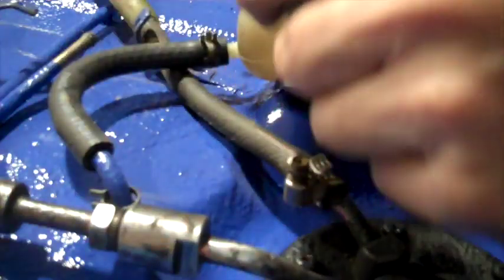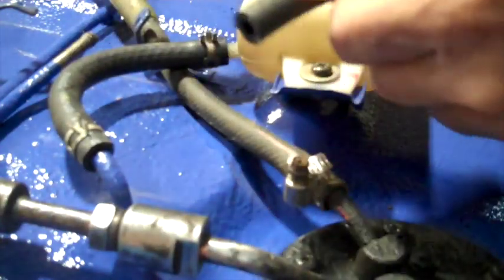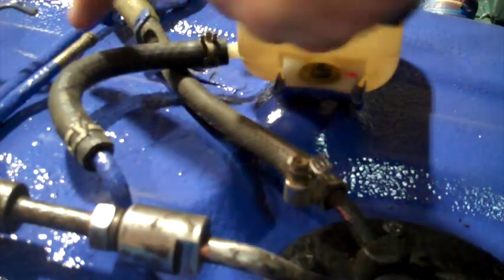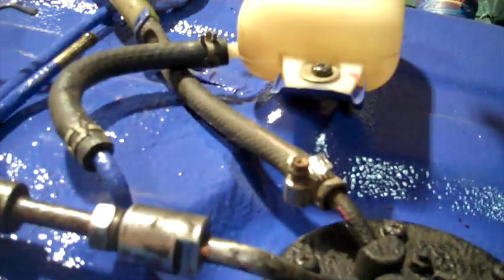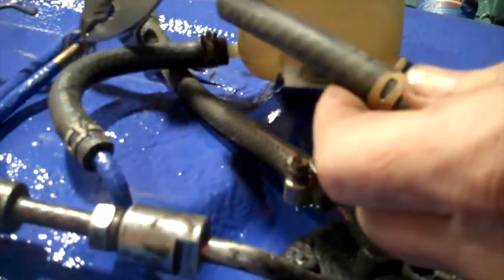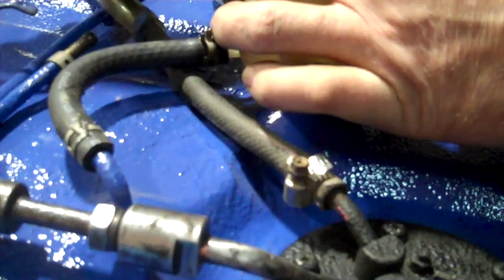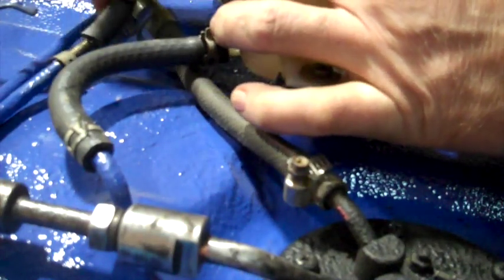This is the drain back. This one's about 5.5 inches long. And this one goes from here to here. Just put a dab of WD-40 on there and they'll slide on a lot easier. Trouble getting those over the knob, so 1/4 inch is a little bit smaller than the original. This one's about 5 inches long.